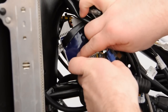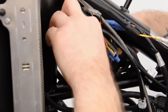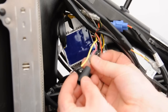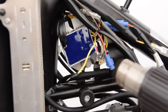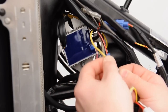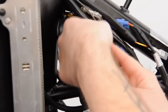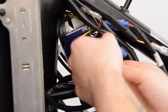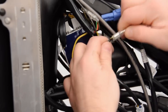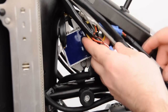Note: the Trail-Tech regulator rectifier will be provided with two additional wires — a pink wire with a spade terminal and a yellow wire with a male spade terminal. In this installation, the pink wire will not be used. To seal this off, use the provided 3/8 piece of shrink tubing, insert it over the spade terminal, and use the heat gun to shrink and seal it off. Locate the single yellow wire on the provided Trail-Tech regulator rectifier, separate from the white 4-pin connector, and plug this into either yellow wire on the new Trail-Tech stator. Locate the white wire in the factory wiring harness previously connected to the stock stator and connect it to the remaining yellow wire on the Trail-Tech stator. Locate the yellow with red tracer wire previously routed down the frame rail and connect it to the remaining yellow wire connection on the stock wiring harness. Lastly, locate the blue 2-pin ignition plug on the factory harness and connect it to the white ignition plug on the Trail-Tech stator.